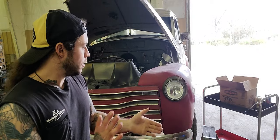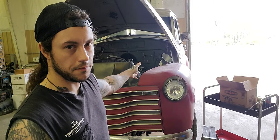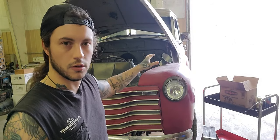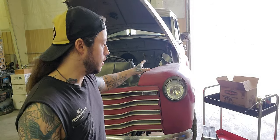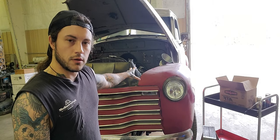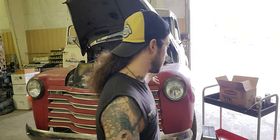So, let's get started. I have this particular situation, I have nothing in the pan, okay? All this unit's been is dyno tested. There probably is 1 quart of residual dyno fluid in it, but that's it. There is 1 quart in the converter prior to install. So I'm going to add my 6 quarts now.